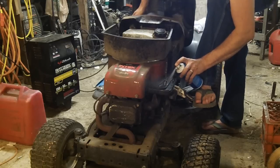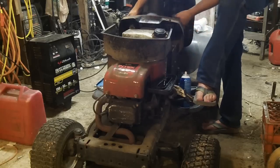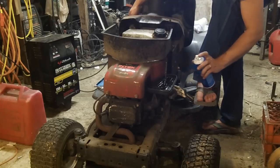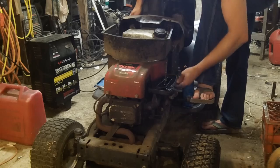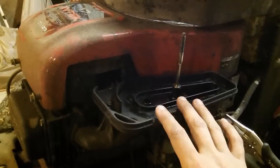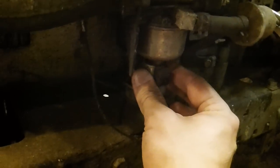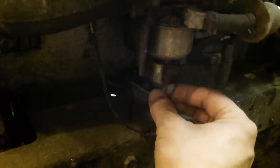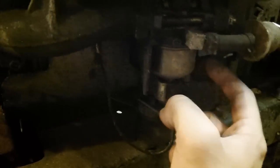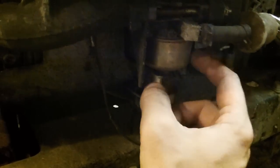Nothing at all with it closed off, but with starter fluid it fires. So at this point we know it's a carburetor issue. I'm kind of glad this happened, but I really want to warn you: underneath here you'll see the solenoid valve — this is an EPA thing — and this thing is insanely hot right now, I almost cannot touch it. That's because it's acting up and it's probably part of what's causing the issue inside the bowl. What we're going to do is disconnect the wire to this, drop the entire solenoid valve out, drop the entire bowl, clean it, check the needle valve, and go from there.